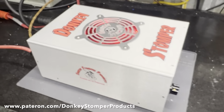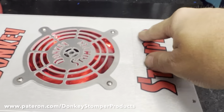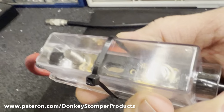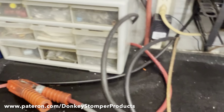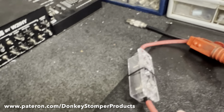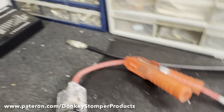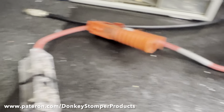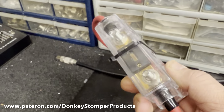Alrighty, guys, I appreciate you watching. Like I said, by the way, you've got relay protection, temperature sensing protection, plus you've got a fuse. You get all that for the same price. I'll tell you something else, guys. People say they need to fuse it to the battery. Well, that's fine. If you want to cut this off and put it to the battery, that's cool. For those that don't have a fuse, I'll have one right here. But if you want to put it to the battery, clamp it off and put it on a battery. Either way, you get a free 20-something dollar fuse and holder right there.